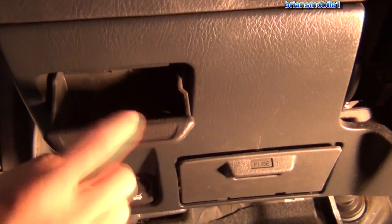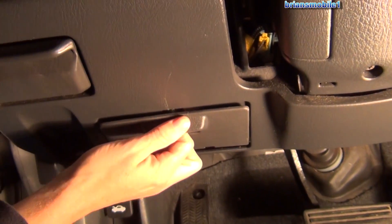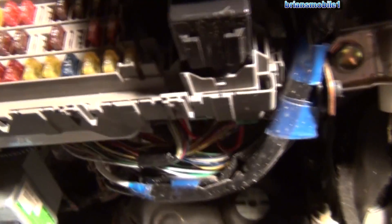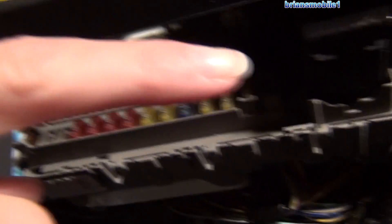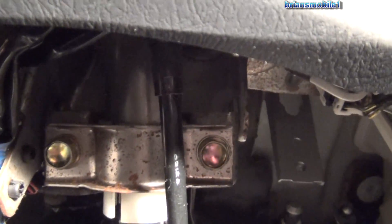Here we have a 2001 Honda CR-V, and we're going to look for the diagnostic link connector, or the DLC. With the Subaru it would have been somewhere like right here — nope, that's just somewhere to put your change. And the fuse box — no, it's just a bunch of fuses and some relays. And then underneath the steering wheel — I don't see it. That's where it's supposed to be. To sell a vehicle in the United States, you have to have the link there for emissions.